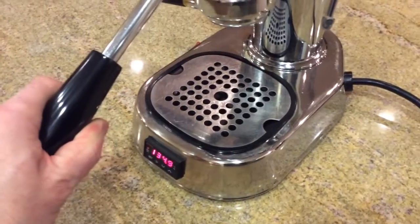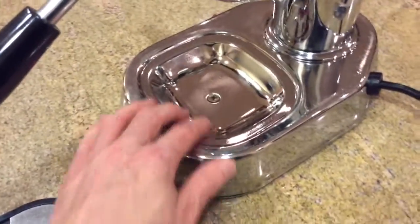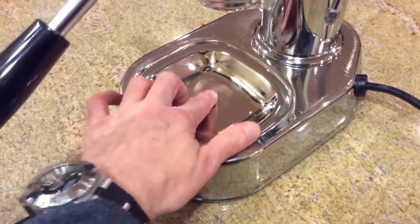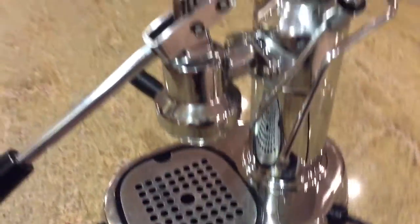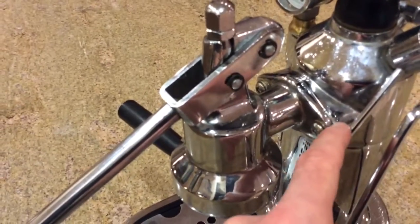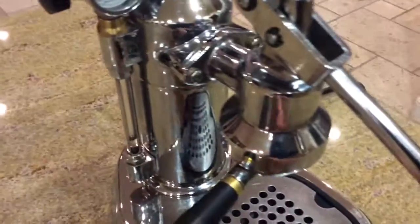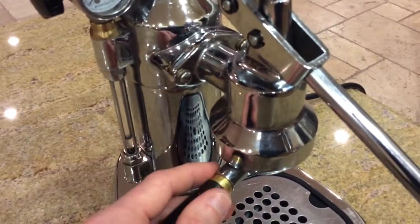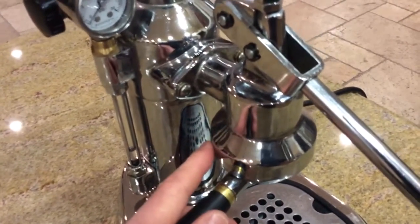There's been quite a bit done over the years. Most of the circuitry is tucked in underneath here. This is a custom bolt that I made to hold the machine together. All the gaskets have been replaced, the threads on the attaching bolts have been chased, and longer stainless steel button-head allen cap bolts have been installed. I've had the group head apart a number of times — cleaned it, inspected it, replaced the gaskets, and changed things over to stainless steel clips internally.